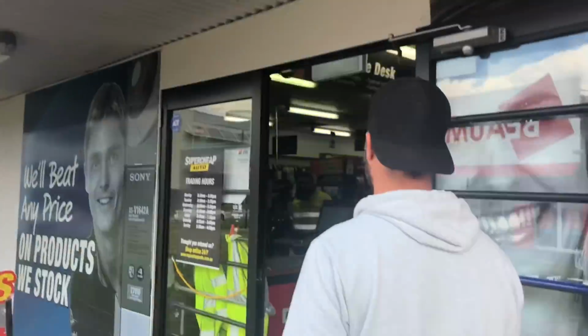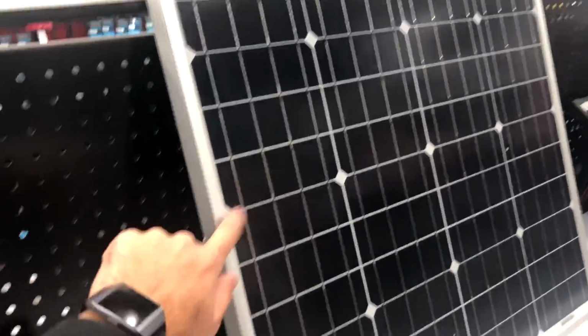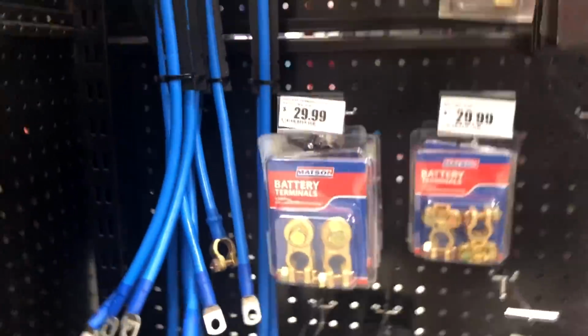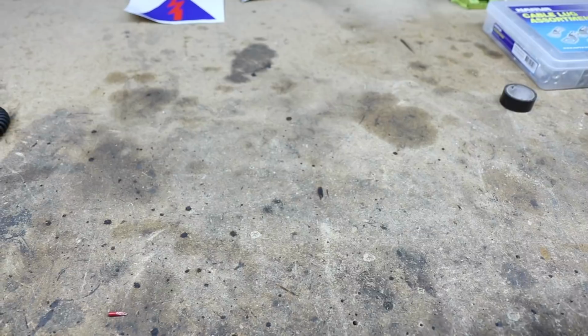We've just finished the RB26 conversion on our 240Z and it's been draining batteries. We since worked out it was an issue with the alternator wiring, which we've fixed, but it got us exploring options for cutting power. You could just pull the negative terminal, but there's an even easier way to isolate the battery with the flap of a wrist.